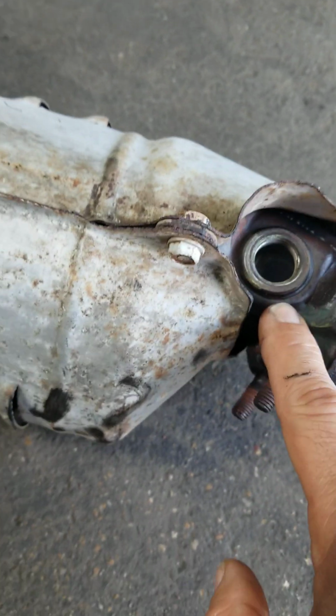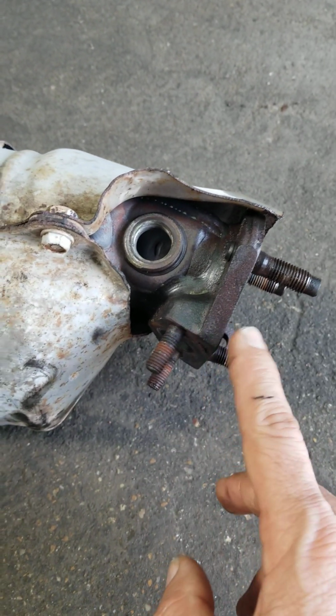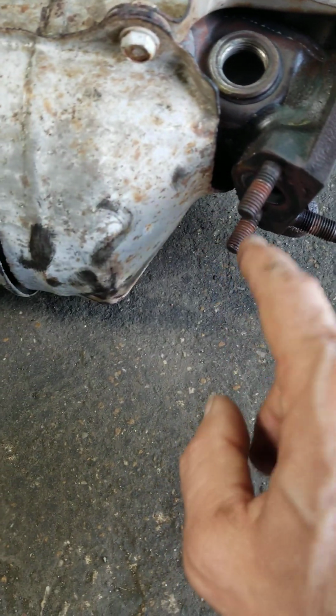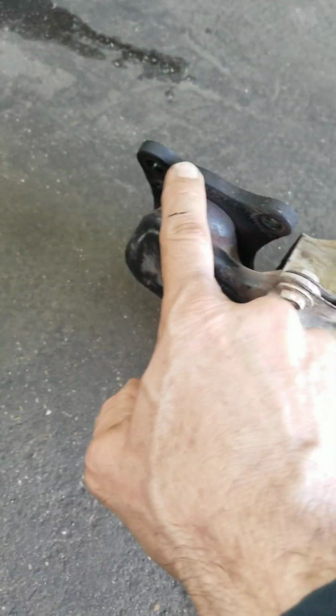First of all, the upstream oxygen sensor and downstream need to come off. Make sure you disconnect them, and make sure you don't switch them. Then put some WD-40 or PB Blaster, and loosen this screw and these two for the EGR valve. And here, make sure you always replace the gasket on this vehicle, on any kind of vehicle I mean.